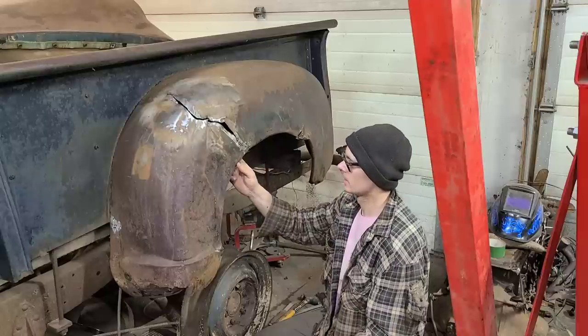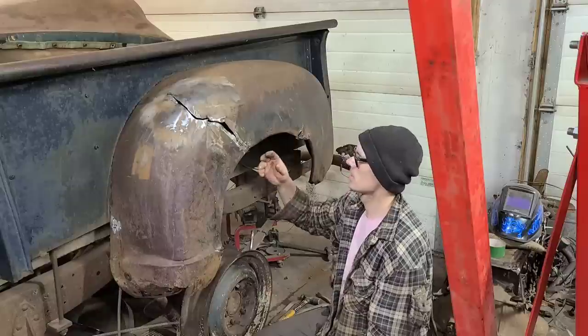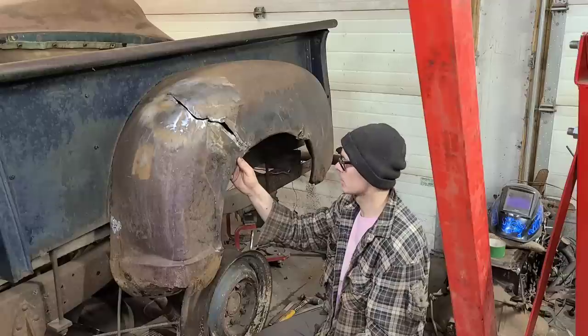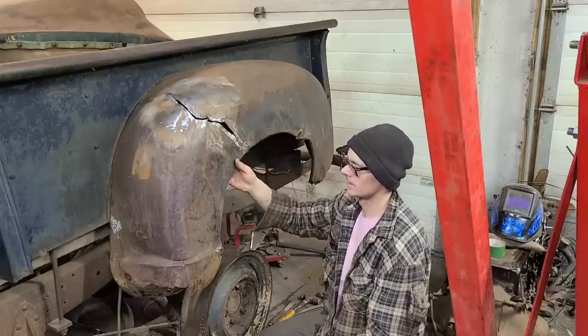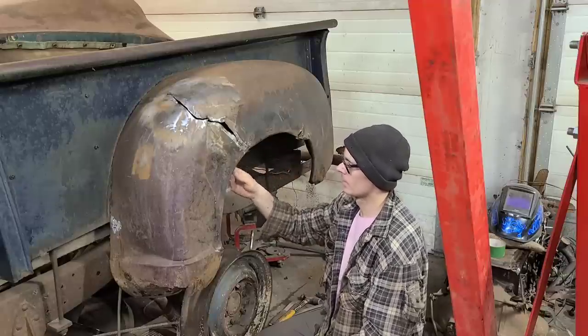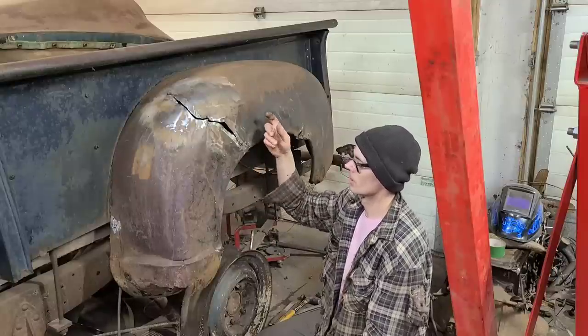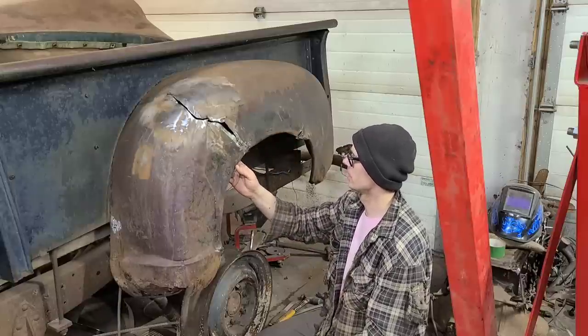And it sounds crude to just fill stuff, but really, once you get these edges and your body lines back, that's usually 80% of your damage comes out. And you just fill the rest, and if you think about it, the first thing that's going to get chipped is if you got Bondo on your edges or on your body lines. So those repairs usually held up quite well, actually.